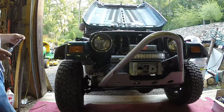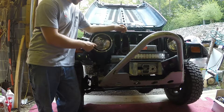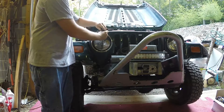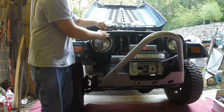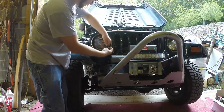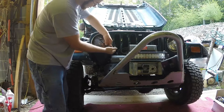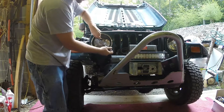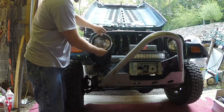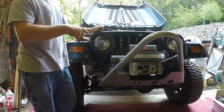The first thing is you have to remove the T15 screws around the headlight bezel. I prefer using a screwdriver type because some wrenches don't fit in there quite the way they should. There are three, but you'll notice I only have two on both sides. Then you're going to try to wiggle out this bezel and pull it off — sometimes that can be one of the harder parts. Then you're going to repeat the same for the other side.